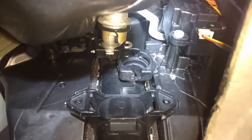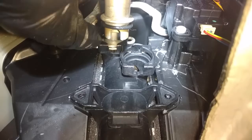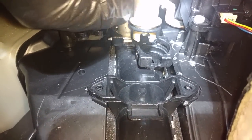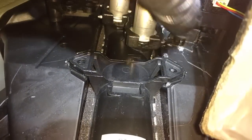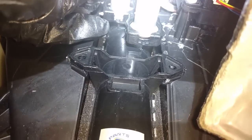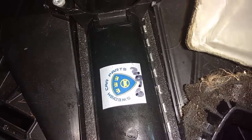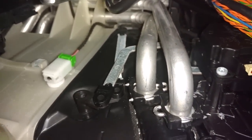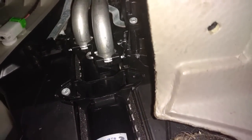The other side has a retaining pin. When you put the retaining pins in, make sure they're all the way set and you can see the prongs sticking out the other side. The lower one had a problem coming out because it was in the way, so I'm inserting it in the other direction — not sure why they didn't do it that way originally. The clips are in and they're secure. I'm going to fill the coolant system up, leak check it, and then put these panels back on.